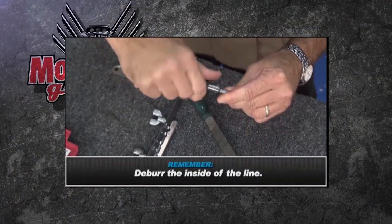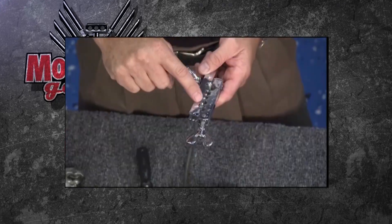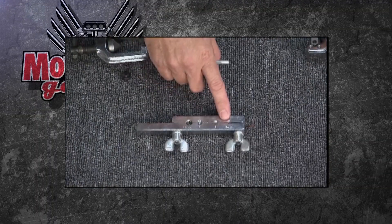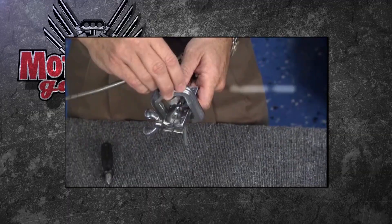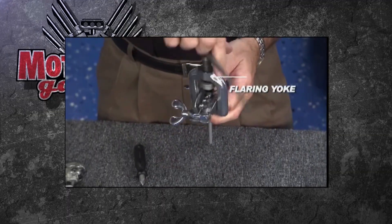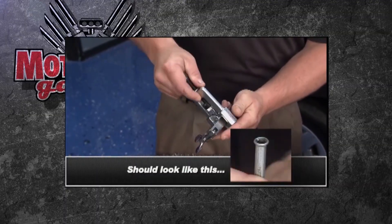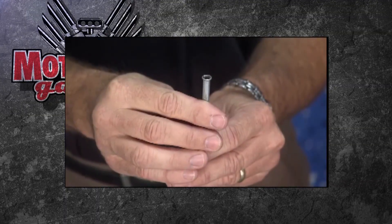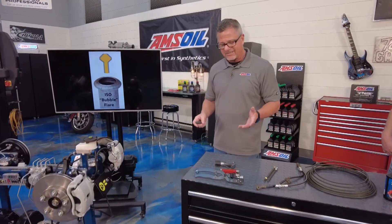It's kind of a process. First thing you want to do is cut your brake line and then ream it out, take a file, chamfer the edges, make sure it's nice and smooth. Then you're going to need this kit - called a flaring bar. You find out which one fits your line, put it in there, put your flaring adapter on, then use what's called a flaring yoke. Go down, flare it, pull that out, do it a second time, and you're going to get a good flare that looks like that.